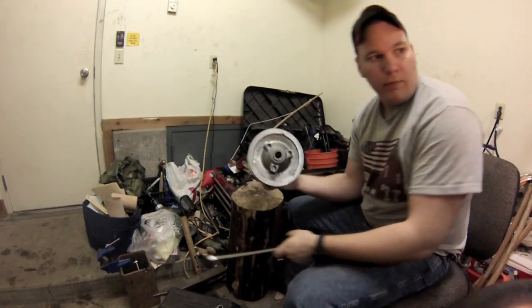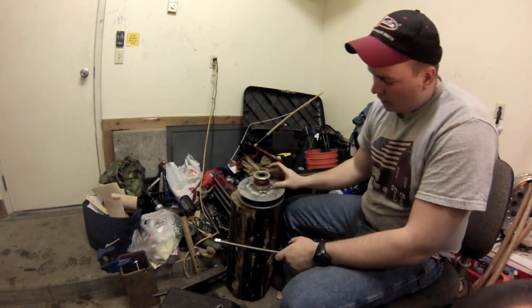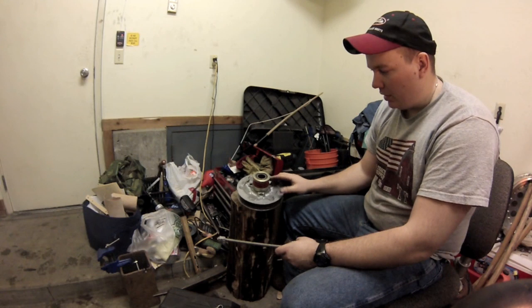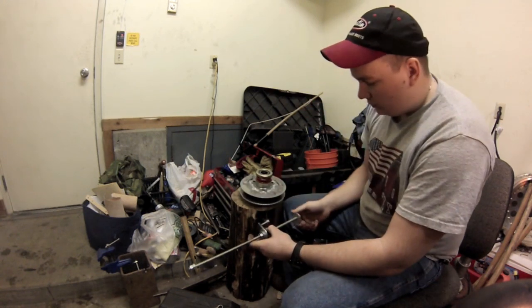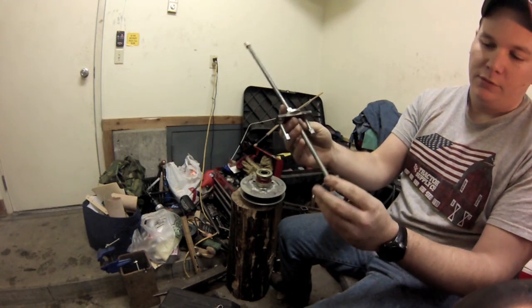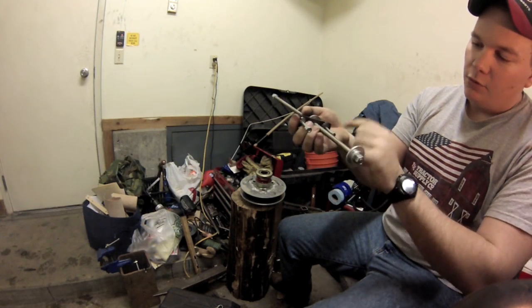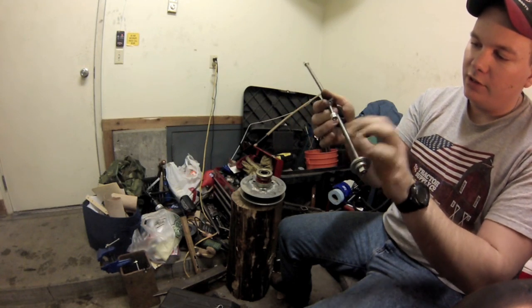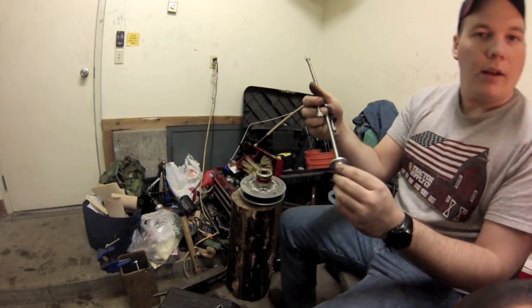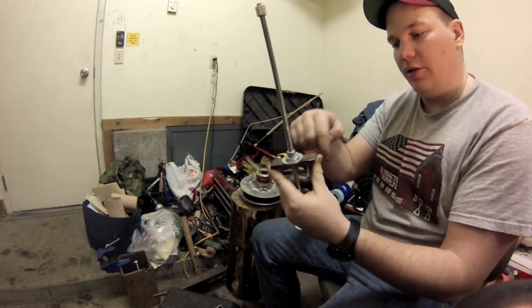All right, now first thing, we're going to start off with the secondary clutch, because I put an EPI red spring in one time, and this is a little bit hard to do because it's such a big spring. This is my homemade compression tool. Just took a piece of 3/8 metal, welded two little 1/4-inch bolts on there. Actually got it too hot on one side, and it's a little crooked, so that's what makes it a little bit difficult. I seen on the internet some guys were taking an iron pipe cap and putting it on here and just cutting a little bit away.